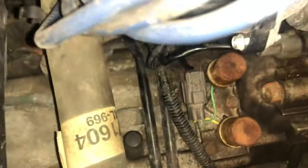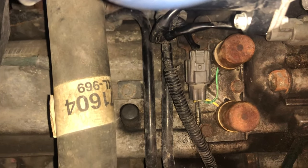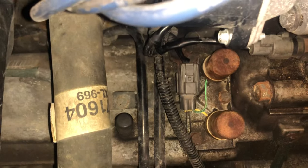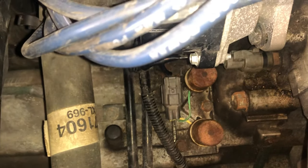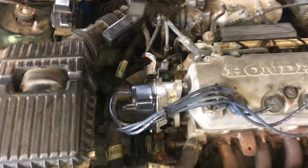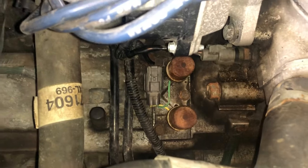Now test the yellow wire — make sure that solenoid opens up too and you can spray compressed air or carb cleaner through it. Sometimes when these go bad — they're like $100 to $250 depending on where you go — you can just clean them out and they work again. That's an easy 10-minute job where you clean and test at the same time.